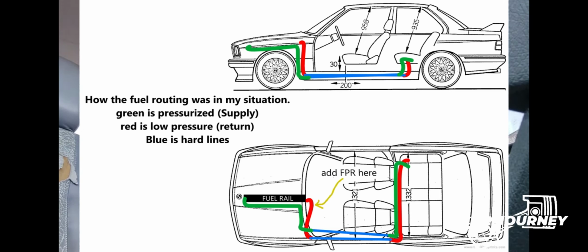From that point onwards, there were a couple of things I had to do. I had a leak on the fuel pressure regulator, on the hose barbs that screw into the regulator itself. Someone told me that Loctite works for sealing it up, but I couldn't find my Loctite, so I just used thread tape again. That's suitable for fuel fittings. I placed it on the return and the pressure supply, and once that was done, the main system was okay.